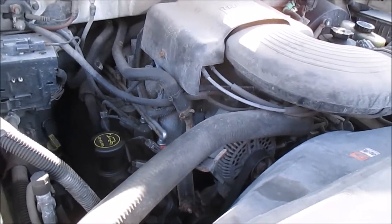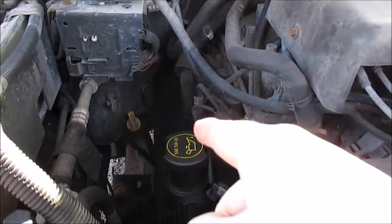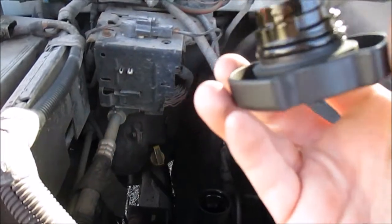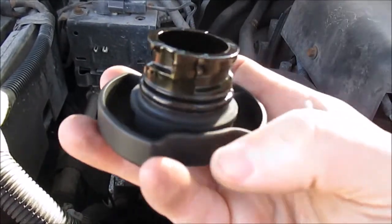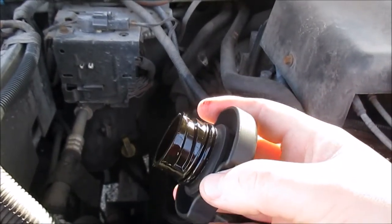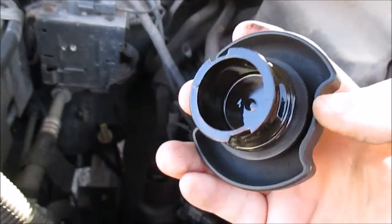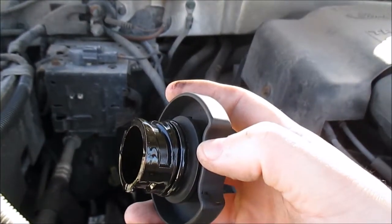I'm out of my 2003 Ford F-150. I live near Kansas City, Missouri, and for a while I was checking my oil. One day, it had been really cold — cold, hot — and I opened my cap and I just had a bunch of freaking milky gunk all over it. The first thing I thought was, man, I probably have a bad head gasket, because I have all that white milky stuff inside my oil cap — I must have coolant getting inside mixing with my oil. But it turned out I think it was just because of the cold weather — cold, hot, cold, hot — moisture can build up.